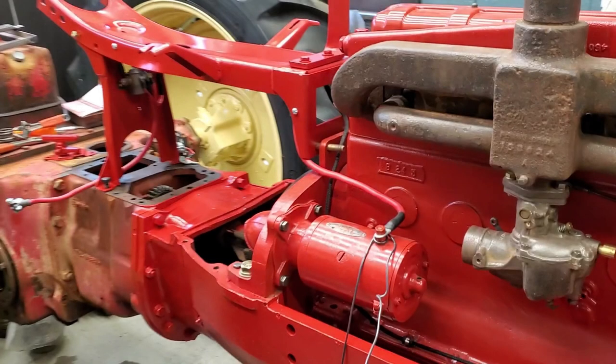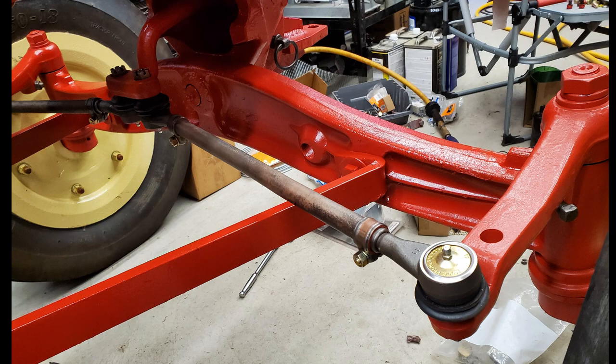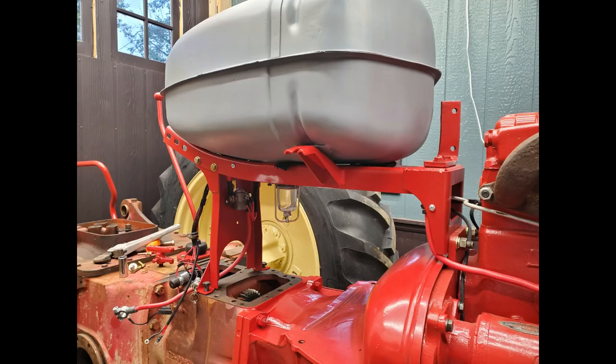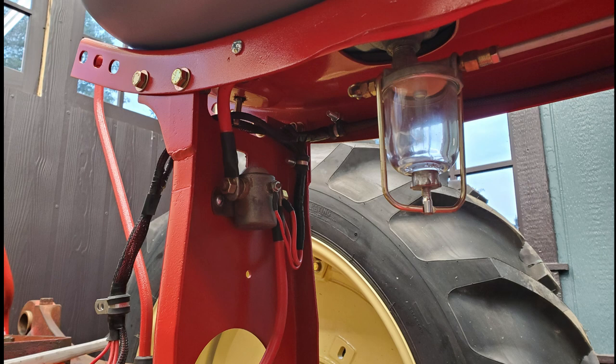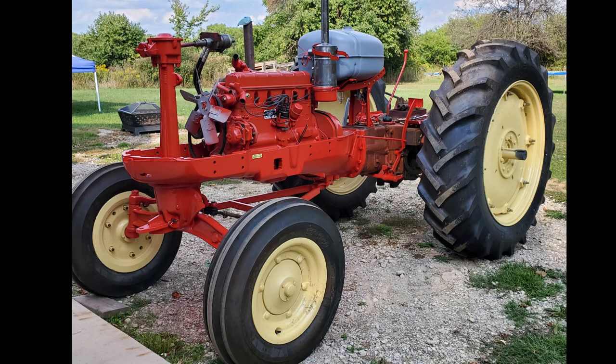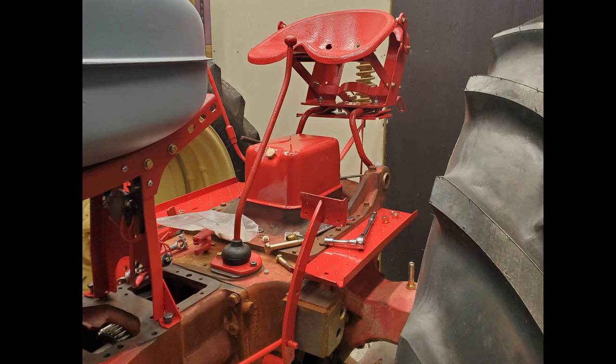With the engine installed, I started first with mounting the fuel tank bracket and the dashboard. I took a brief pause to address the tie rod ends that were in horrible shape — found some suitable replacements and readjusted them before they got repainted. The fuel tank was next, now in primer, and the meticulous work of running the wire harness, fuel line, and gauge senders proceeded. The hydraulic reservoir was vacuumed out and cleaned of debris, and I started reassembling the pedal package, the seat, and various engine accessories. Many of these would come off later to paint the rear axle, but at times like this I like to do a part fit-up for familiarity before I do a fresh paint.